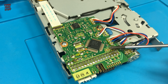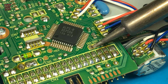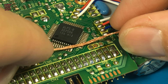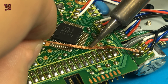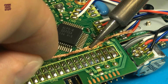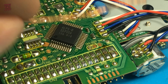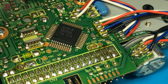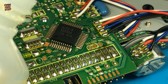Let's get this solder jumper moved. I think that's taken all the solder off but let's be careful and use some solder wick - always moving the solder wick when heat is applied so it doesn't stick to the board and rip off any pads. Before we put some fresh solder on the DS0 jumper, let's put some flux on the board. This will clean the pads and make for easier soldering, and I'm all for easier soldering.